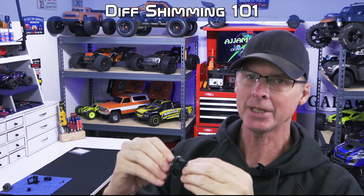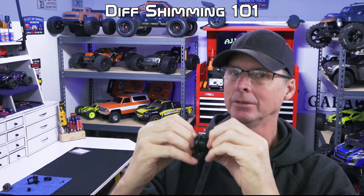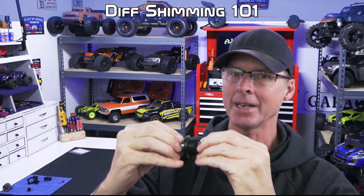That whole situation there, that was from side pressure. When I put it in there, I shimmed it, I put too much pressure on, and lost the front bearing. These are designed to run in the channel. They're not designed to be pressed up against that. Now, it does work, but it's really hard on the components, so I wouldn't recommend it.